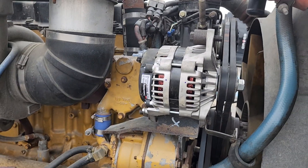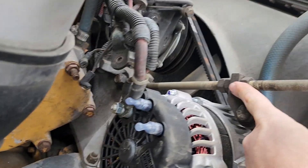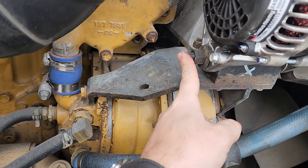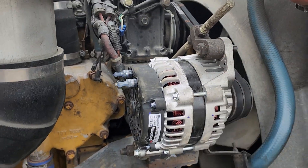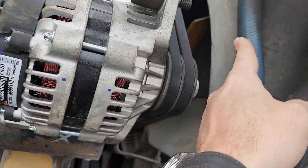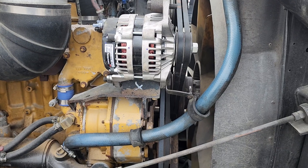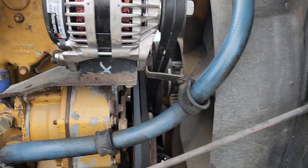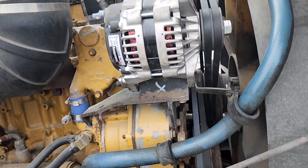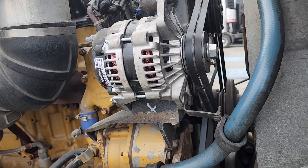For anyone who might want to do that themselves: this here is your adjuster for the belt tensioner. You need to loosen up that nut and then the two underneath it — you can loosen those up, loosen up that bad boy right there and that one there. They're like 19 millimeter, and then you can shimmy off the belts. Those you can just fit around the fan blades — you don't have to take off anything. It took me and my dad like an hour and a half. I went ahead and replaced the belt too because they were kind of cracked. Now she's charging and looking good.